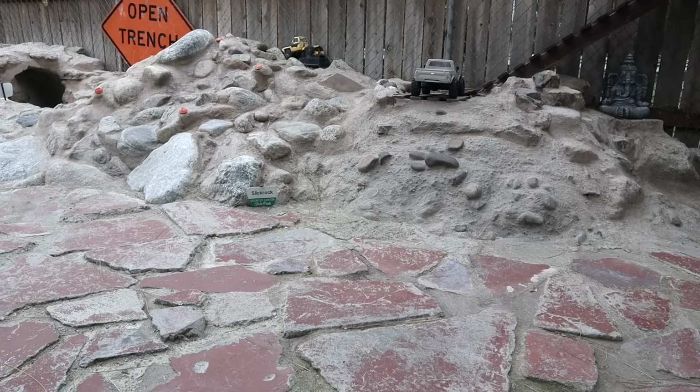And the beauty of geometry and triangles, because the wheels are effectively so far apart relative to the vehicle, those wheels look really good with that body. It basically makes the center clearance effectively worse. It's easier to get the pumpkins hung up because they're farther away from the tire.